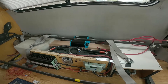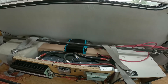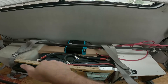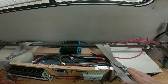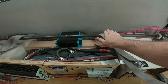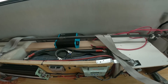As with any custom job, I ran into one little snag: while installing the charger I remembered the seat belts on this old van come up through the couch. I don't want the seat belts to fall back down on any of this electrical stuff when they're not being used or when shoved down to sleep. So I'm going to build a wood shelf that goes all the way along the back so none of the seat belts can drop down and contact any of this metal.